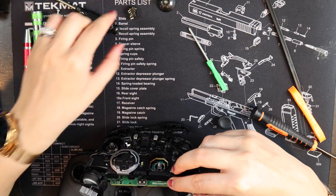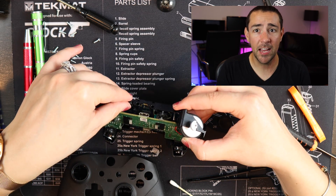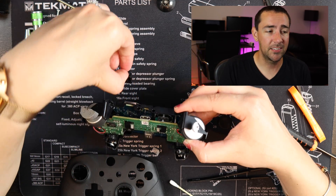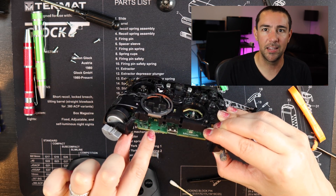This is that 3.5 millimeter jack, and you want to make sure that the contacts will be facing the green board because there are no contacts on the blue board. It will just kind of sit there, but the contacts will be facing the green board and it will jiggle a little bit until the case is all set and ready.